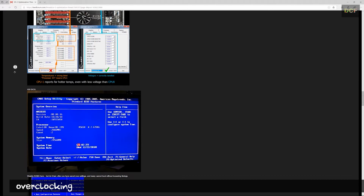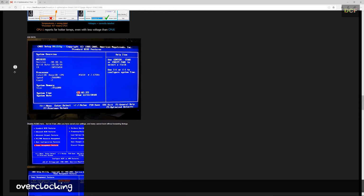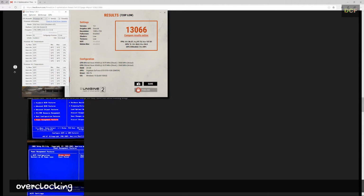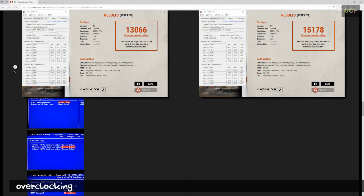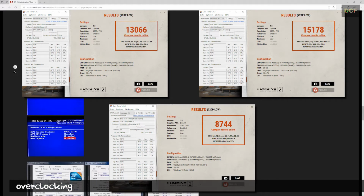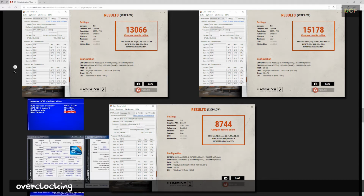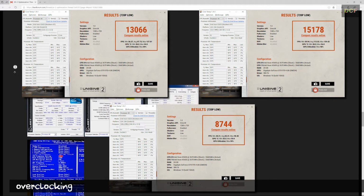I tested 3DMark and Superposition and the result was somewhat surprising. The higher the clock speed, the lower the graphics results were. The sweet spot was 188 MHz base clock. Everything above decreased the graphics performance. Still don't know why yet. I used the BIOS configurations of other SR2 overclockers on the internet, who went beyond 200 MHz.